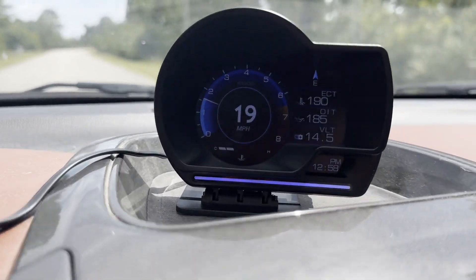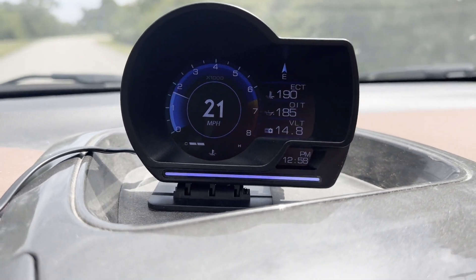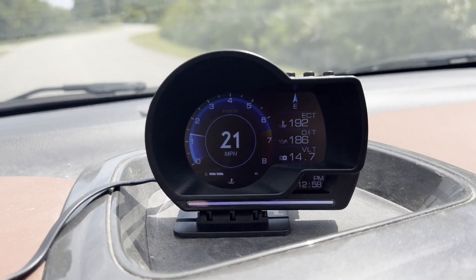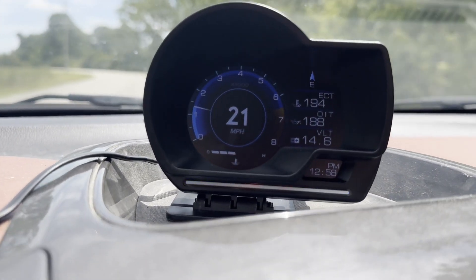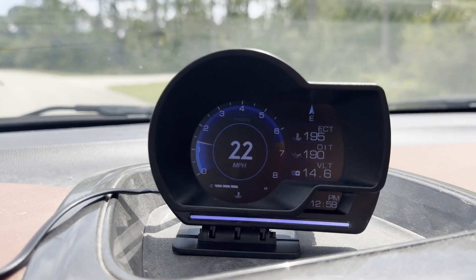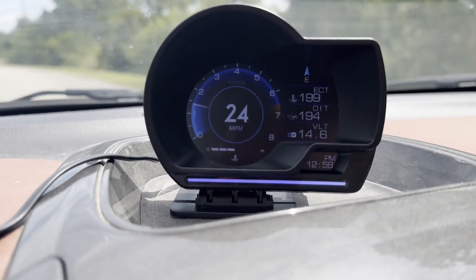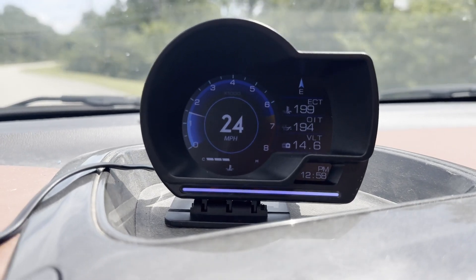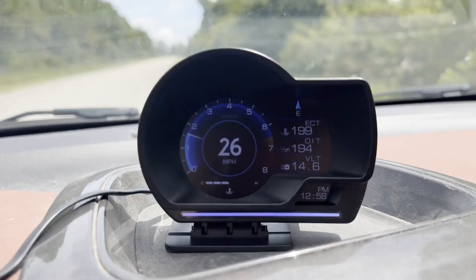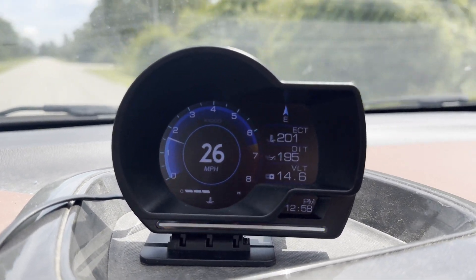Test driving around now. The new thermostat definitely shows it's running — we've got the new thermostat installed, fluids in it. It gets all the way down to around 178°F, so it's keeping it cooler. Maybe a new sensor too, who knows. It's staying tight so far.